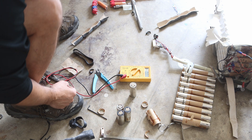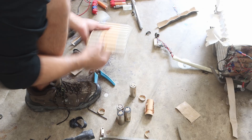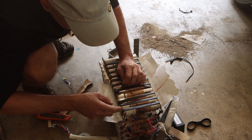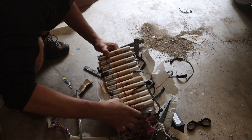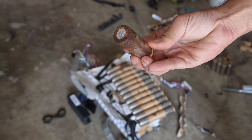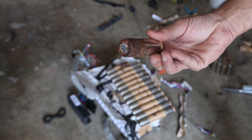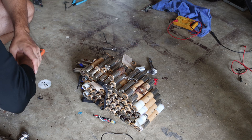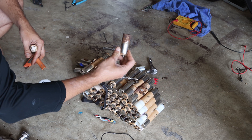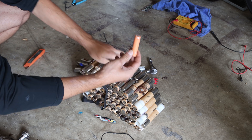This one's kind of good but I don't think I can charge it. I'm going to keep checking all of these batteries, hopefully we're going to figure something out here. These are just completely falling apart here — these are the negatives right here. Look at this battery. Now you might be asking what is wrong with this Zero, why isn't it powering up — that might be one of the reasons. This is the Zero battery pack, it's in terrible shape, lots of issues. All corroded, and each one of these cells is dead — I'm getting 0.03 volts.